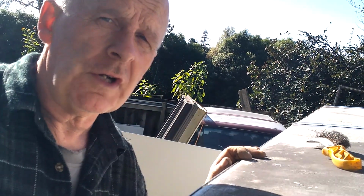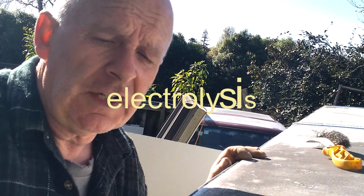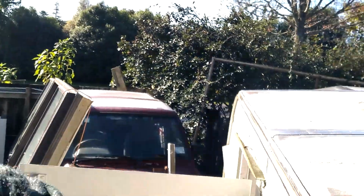They nail the aluminium skin to the wooden frame with steel nails. The steel and the aluminium set up a galvanic reaction, and over time it bores little termite holes in the aluminium. And this is what I'm dealing with here. Come and look.